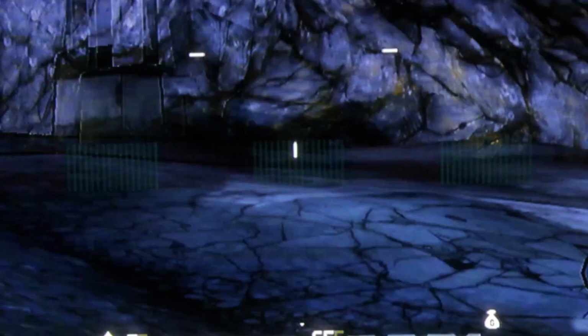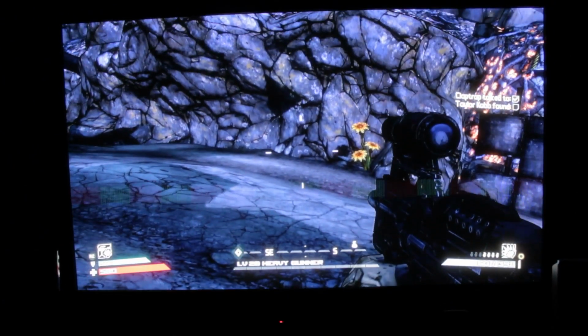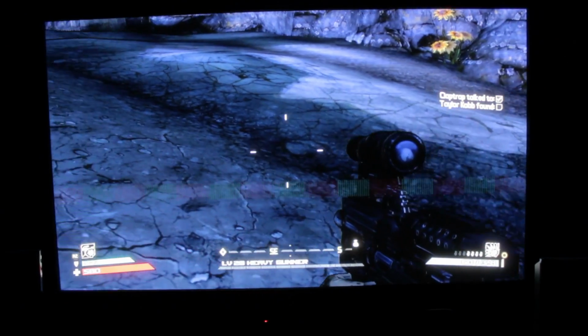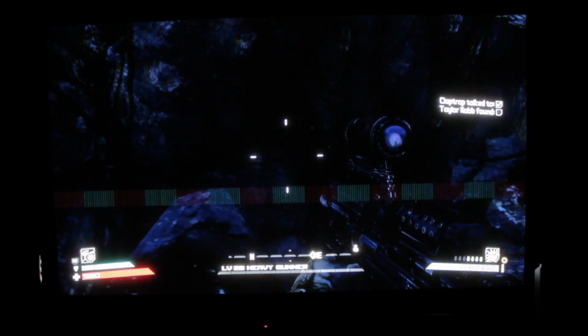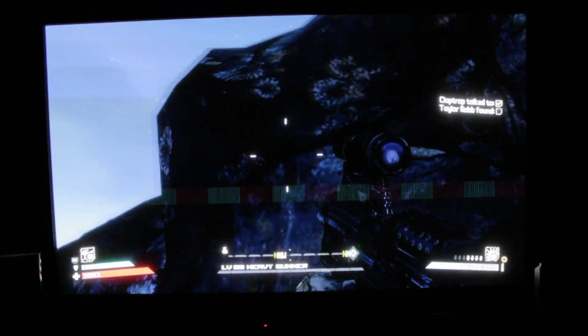In this video I'll be doing an installation guide slash tutorial on how to replace the A board on your Panasonic Plasma screen. What you might be experiencing on your screen is bars going across the screen, whether horizontal or vertical, and they might be different colors. Mine happen to be green and a reddish color, like a light green, almost blue, to a red. You might be experiencing something like this. This is when it's just a black screen, so you can see it very prominently. The main cause of this is overheating, and that means using your TV too much. So what you're going to have to do is replace the A board.